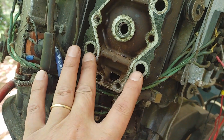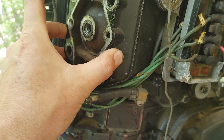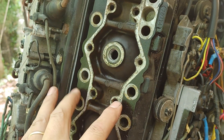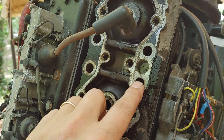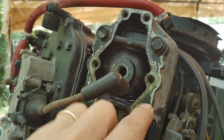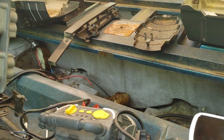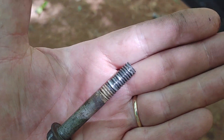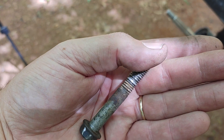We'll just kind of move on to the next step and take the head off and go from there. So I'm trying to take the actual head off — I've gotten about this far. These came out pretty easy, these weren't bad, that was okay, that one was a pain in the ass — it stuck. That one was a little tight, and these two I got them to break loose but man, they are tight. It actually looks like it's taking part of the metal — you can see where it twisted the threads.